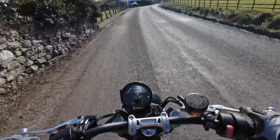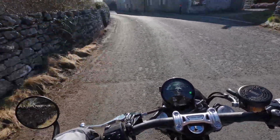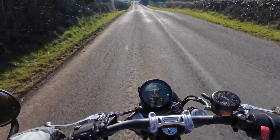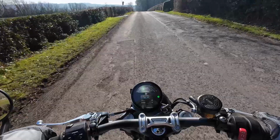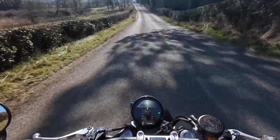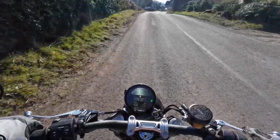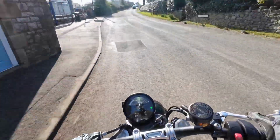Bike comes equipped with lean sensitive ABS and lean sensitive traction control for the first time for this 2025 model. So within the IMU on the bike, it's got this lean sensitive sensor which obviously determines how much lean you have going into a corner, and it constantly monitors and adjusts if necessary the ABS and the traction control depending on your road conditions, which is handy to have.